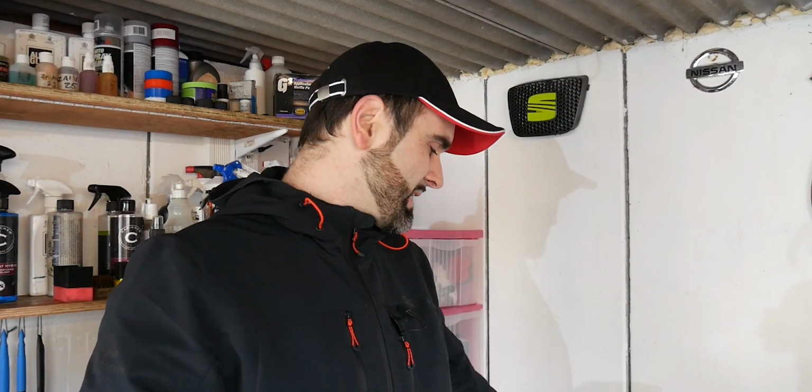I've done some maths here, and that equates to 236 ml into 3.785 litres. Break that down because I don't want to make up that much product. Roughly that comes to 47.2 ml into 757 ml of water, so you're almost going to get close to a litre of product. If you round those figures to 50 ml into 800 ml, that gives you a dilution ratio of 1 to 16.